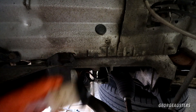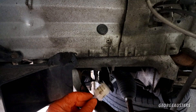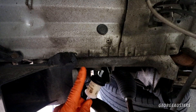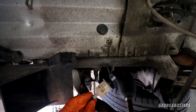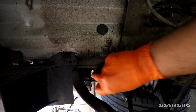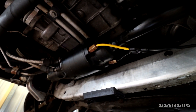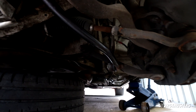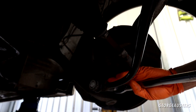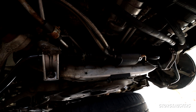I need to install the new filter and that grommet as well. First thing is to feed this hose through this cap and onto the end of the filter. Then push the filter into the slot in the subframe. The grommet doesn't actually slot into anything — it just stops the filter from rattling. The cap can be reinstalled. The vent pipes have been reinstalled and tightened down. Now I just need to torque down the sway bar link nuts. The dynamic drive anti-roll bar has been replaced — just need to get the car back on the ground, top up with fluid, and check for leaks.